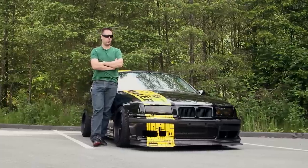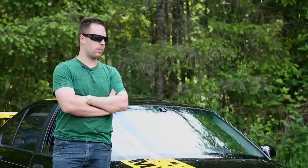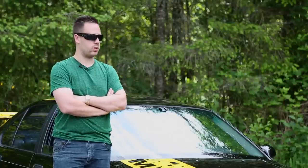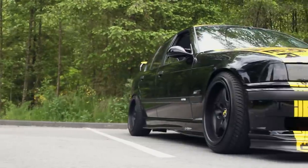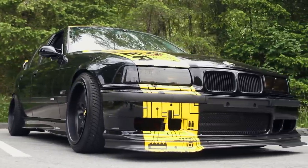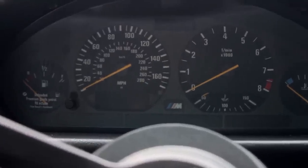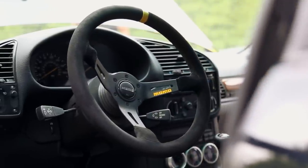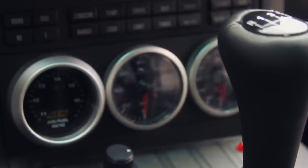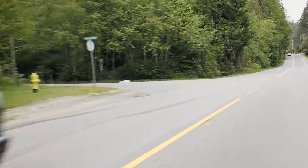It should be 300 at the wheels. That's what the big black dyno drag strip says. When I had the cams advanced, I had some special cam timing that I was trying out. It was doing about 107, 108 in the quarter mile. I put it back to stock cam timing, and that's when I hit the dyno, and it was 275 at the wheels, but I was 8 miles an hour slower in the quarter, so I know I lost 20 to 30 horsepower there.